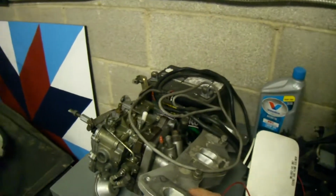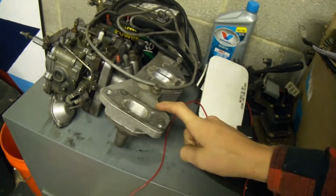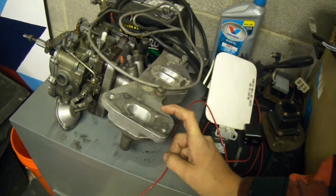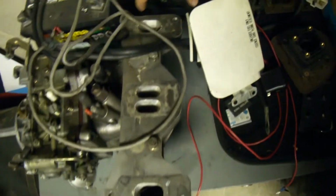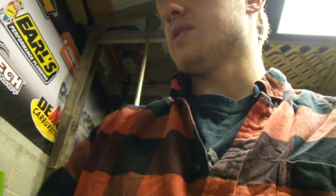And then something that's super neat, this fancy adapter thing is a 4-port old school to FC Turbo 2 manifold adapter. Now, you might ask, that's a GSLSE engine, that's not a Turbo 2. Well, the GSLSEs and the FC motors share the same intake bolt pattern. So by that I mean, you see how spread apart these are here and here, and then see how close together the ones are on the back of it. So, actually, this will just come right off. This thing, right here. Oh, there's a nut on it. That thing right there. See how small those are, how big those are?